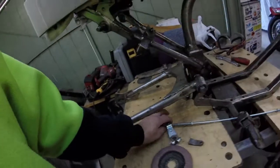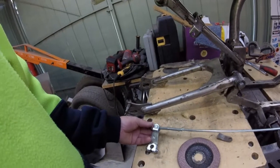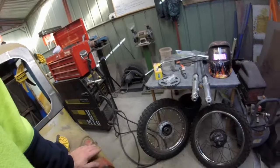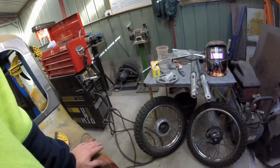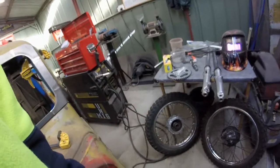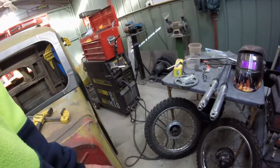Other news, the back brake hub, I ended up getting the cam pin, as you know, and I got all of this sent through from Mick Hone, Suzuki. Guy's been absolutely fantastic in helping me piece together a braking system for this. We drilled the hole out in the hub the other night to take the new cam, because the new cam I think measured in at 13.5 and the original KTM hole was 12mm. So that's all been done. That all fits. It's good.